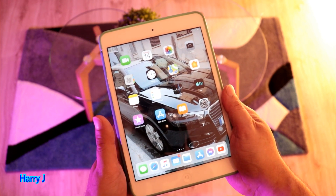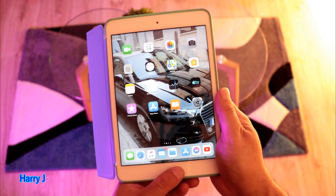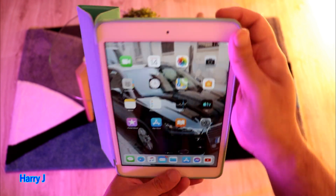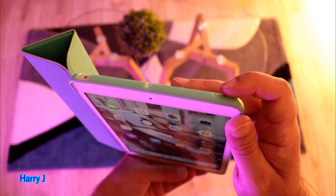What you can do — this is a very easy fix. You have to hold your home button and the power button, both of them together. The power button is normally at the top.